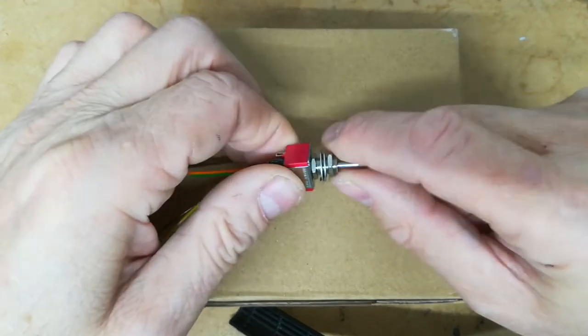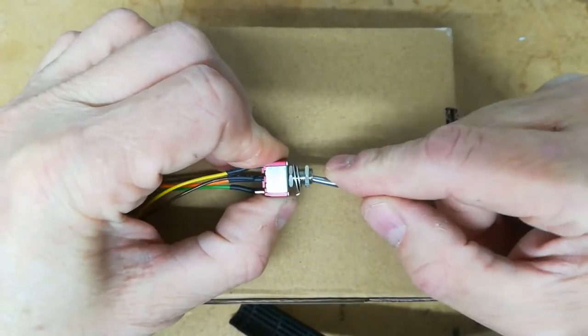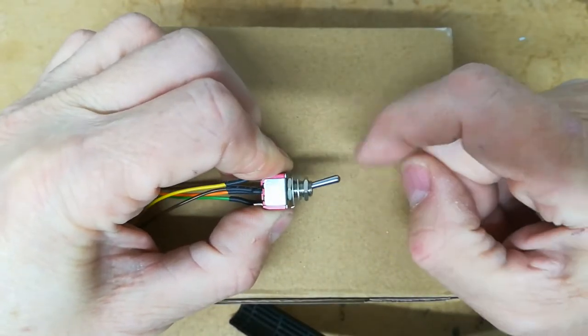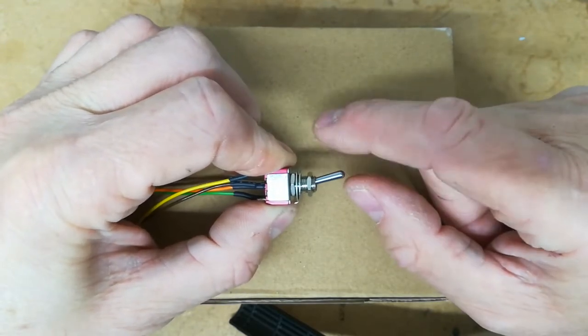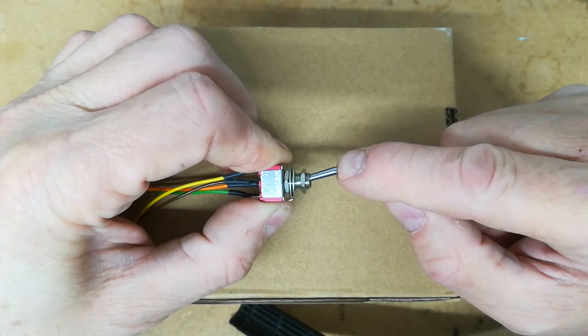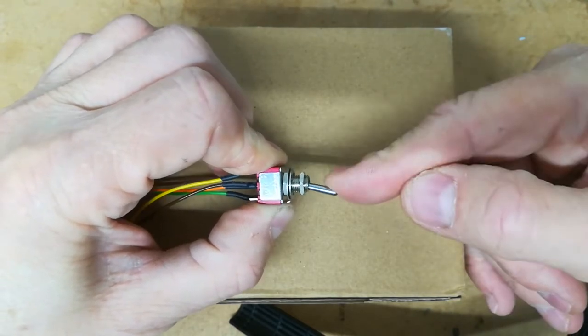So it's a double pole, double throw switch with a non-locking position, which is the brake. And then we've got the clutch, which is up. So disable clutch, or press the clutch if you like, hopefully disables assist and regen. That's up. Want extra regen? Pull it down towards you.